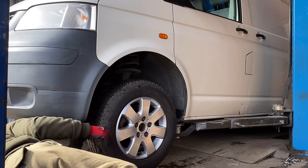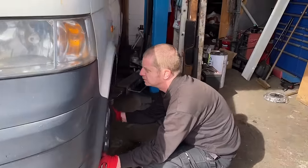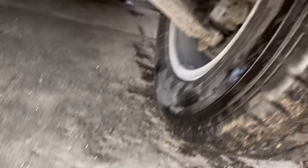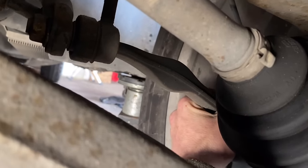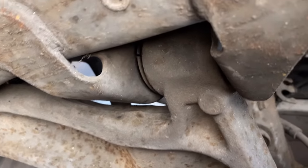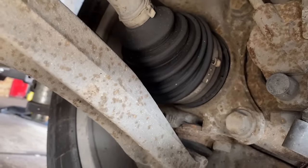I'll get an extra pair of hands to rock the wheel while I check it out with the camera. I managed to find Pinch — thanks bro. It's just the front that you can feel moving. Looking at it: we can see the drive shaft going in and out — it's either a case of the ball joint or the track rod end. There's a little bit of movement in the track rod end. I don't think it's the ball joint.